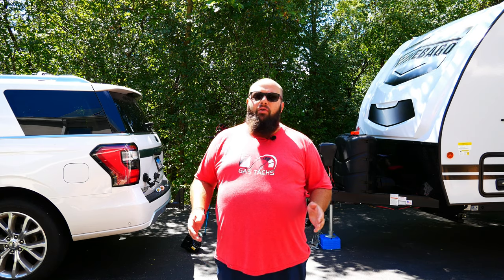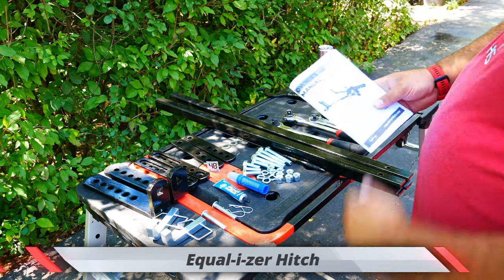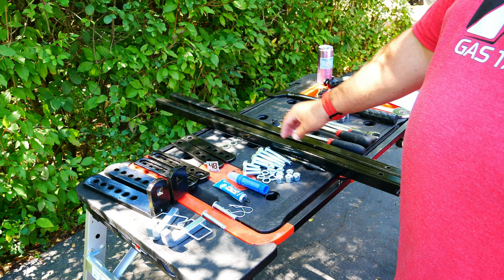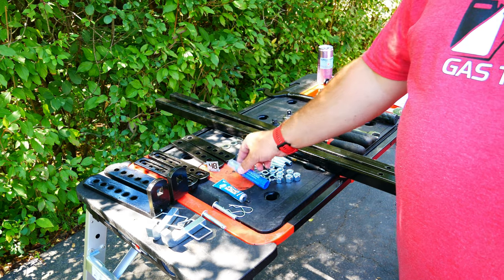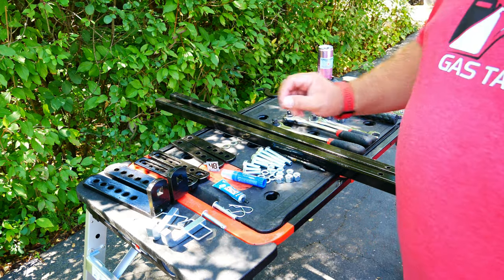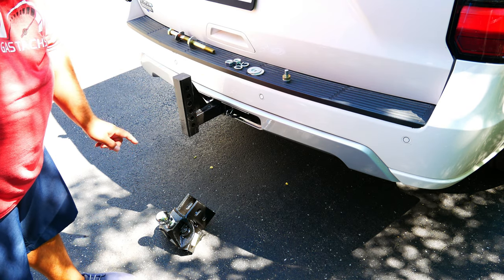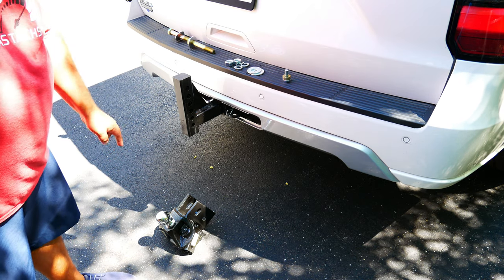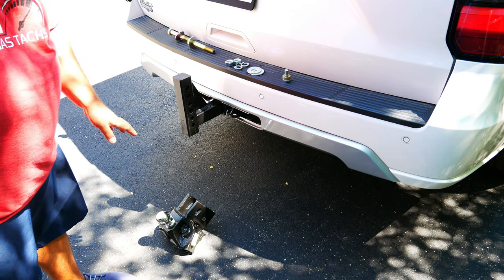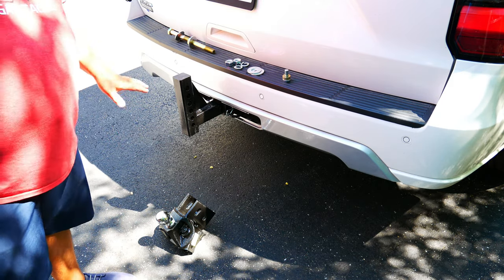Make sure you follow your user manual for all the specs. Right here is mostly everything I need to install the weight distribution hitch. I am installing an Equalizer hitch, rated for 10,000 pounds. I have my tools, my trailer-side weight distribution components, a blue Loctite — not the permanent kind — and tamper-proof torque mark, which gives a visual aid to make sure nothing has moved. On the truck side we have the hitch, the main hitch mount, all the bolts, and the ball. Keep in mind the ball is not included in this kit — it's specific to the size you need on your RV. The ball requires a 44-millimeter nut torqued to 430 pounds, so if you don't have those tools, have the dealership install it.